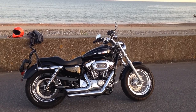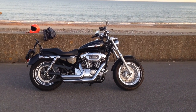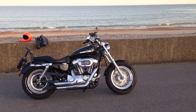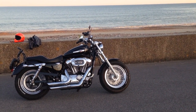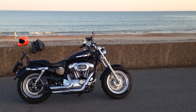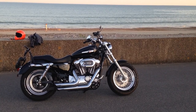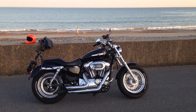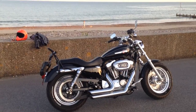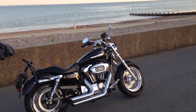So what does it cost? If you go to a mainstream dealer, you're probably looking at anywhere between £1,000 and £1,500. If you were to do it on your own, you can pick up a set of Vance & Hines Short Shots for between £300 and £400, a Fuel Pack 3 for around £300 to £400, and you can get your air filter for between £70 and £100 and fit it yourself. The mapping of the fuel with the Vance & Hines Fuel Pack - oh my god, it is so easy. You literally plug it into the side of the bike, locate the socket, plug it in, download the app to your iPad or iPhone, and then you simply tell it what pipes you've got, what air filter you've got, and it just uploads the firmware. That's it.